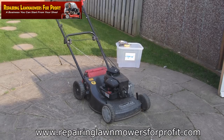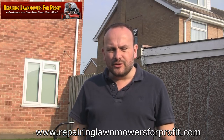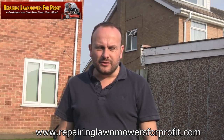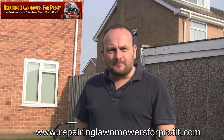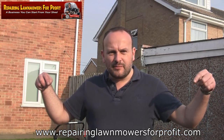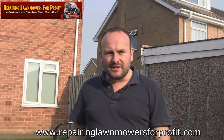I might even do the starter recoil - that looks a little bit of a mess - but I might save that for another video. So I hope this video has helped anyone looking to replace the blade, the blade adapter, or the drive belt on one of these Mountfield petrol lawnmowers. Please be safe - take the spark plug out if you're going to tip it up, tip it with the carburettor up in the air, just lean it against the wall as I did, and keep your hands away from any blades. Big shout out to Pauline Jones, my newest subscriber - thanks for watching. I've got over 5,000 subscribers, so if you're not subscribed please do that.